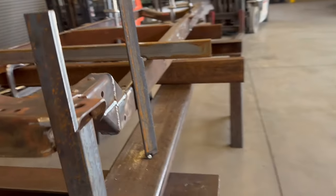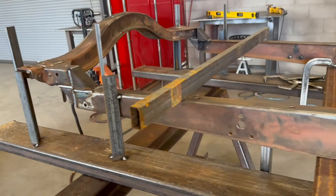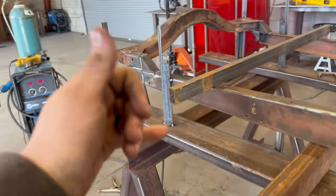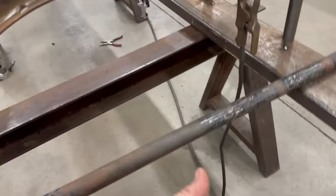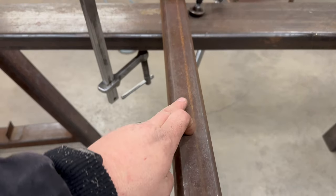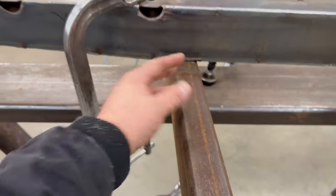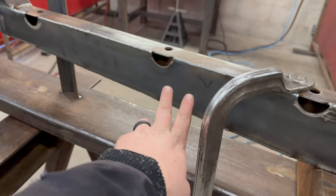This side didn't turn out as pretty as I hoped, but it'll work. The next day I went ahead and welded out the plates for boxing top and bottom. Where the two-by-four section is I couldn't get to directly, but I did it all overhead and flat, kind of bounced around and split the heat. Wrench pockets are done.